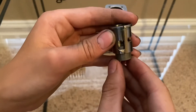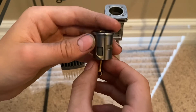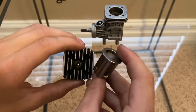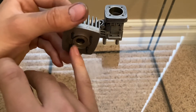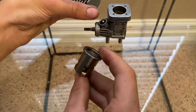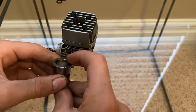The piston rises back up again, sucking more fuel in as it does this, then it creates pressure. You have your glow plug up here with your igniter on it, and what that does is make it red hot. So you've got heat, and then when the head is on the engine you have compression because it's compressing all that air.